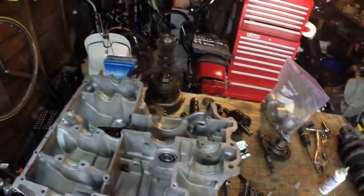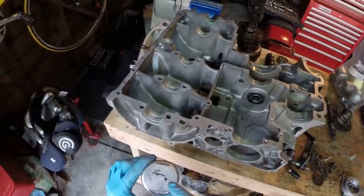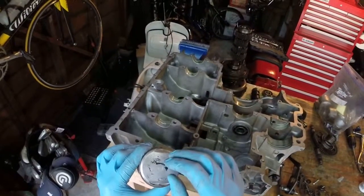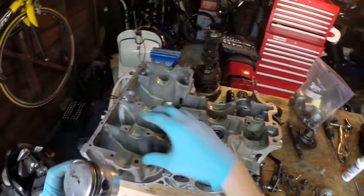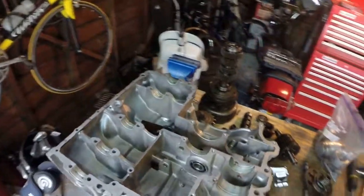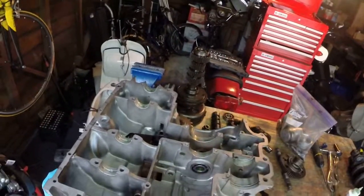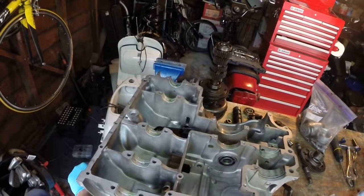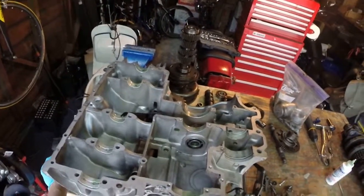When you go through the book, it's like: look at the gears, see if they're worn, if not just throw them back in the motorcycle. But the reason why we took this apart is because one of the pistons was blown out, and you can see the wear on the inside of this one. Little itty-bitty pieces of piston were all over the inside of the engine. It didn't do any real damage — it didn't scoff up the cylinder it blew up in — but it was just annoying and it was all over the place. I was afraid it was going to start getting into the gears. I don't think the person used it much after that, because they didn't get it repaired.